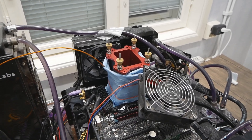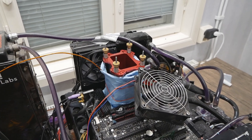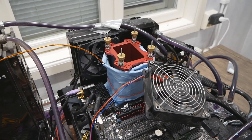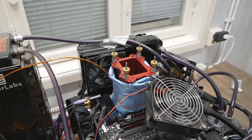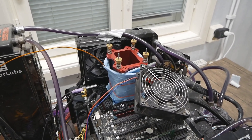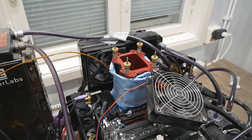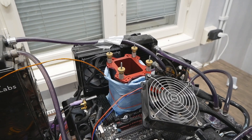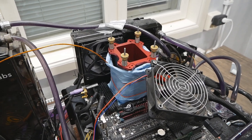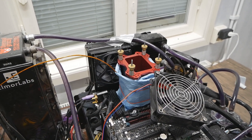In the end, all of these Bloomfield CPUs are essentially the same — just the same CPU with different max multipliers, same thing as Wolfdale on 775 or similar. With the higher models like 965 and 975, the whole thing is easier because you aren't as base clock limited compared to the lower-end models like 920, 930, or 940. We can actually use the multiplier of 23, so it shouldn't be that hard.